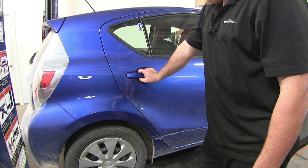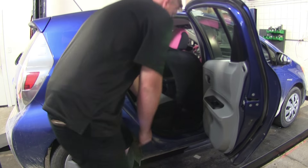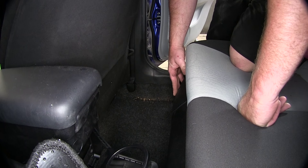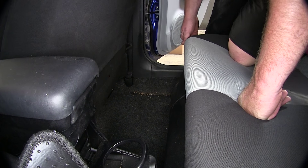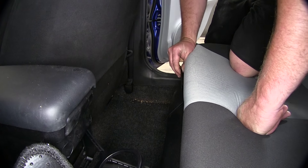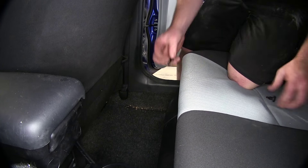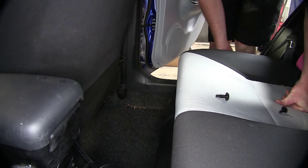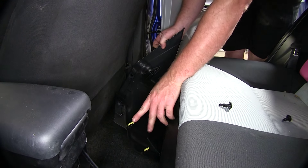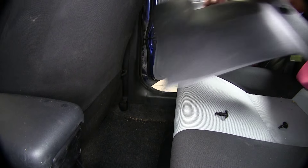The first thing we'll need to do in installing our CURT wiring harness is to open up the passenger rear door and locate the kick panel below the passenger seat, which is this plastic piece here. This is the cover that goes over the top of the battery. Locate the two fasteners, one located here and one located here. Press in on the center to release and disengage the connectors, then guide it out and away. Go ahead and remove those two connectors so we can guide the plastic piece out. Pull out from the back side and push forward — you'll see that it disengages those two there and then we can remove it. Set this off to the side so we can continue with the installation.